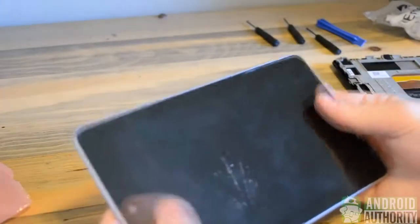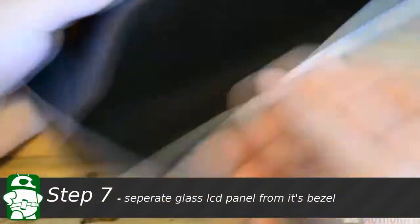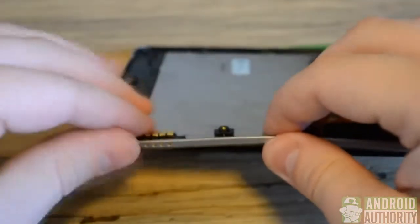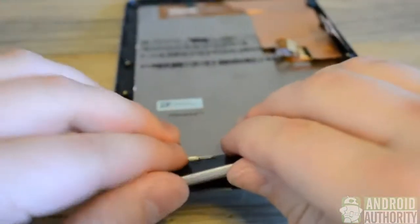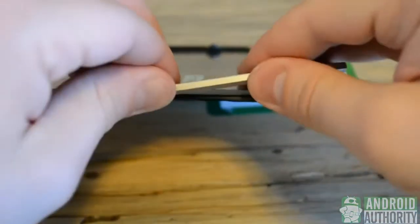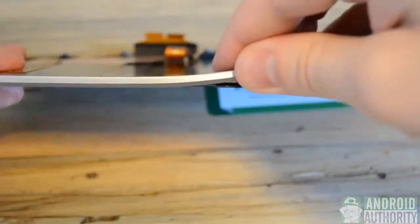The LCD and digitizer is connected to a bezel, and if you didn't buy a full new bezel and only the LCD repair, you'll want to be careful of the pogo connector because you'll have to get that off intact. What we'll do is use a heat gun, or you can set it in the sun, to remove the adhesive tape that connects the panel. I chose to set my device in the sun as I didn't have a heat gun, and after 30 minutes there is some give to the adhesive. We're going to gently work our way around the perimeter of the tablet and remove the adhesive, being very careful right around the cracks of the screen where they reach the perimeter.